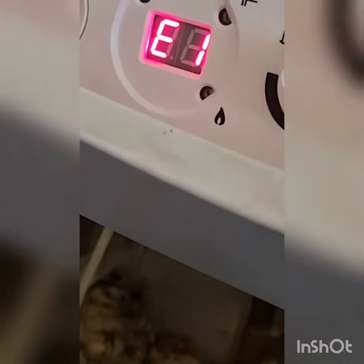I will show you how to clean the condensate filter. Underneath here, you can see this panel — you can open it with your hand. If there is any blockage, any dust or something, there will be a flow issue here.